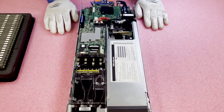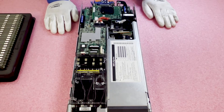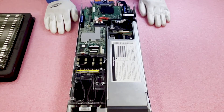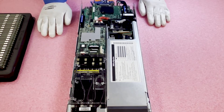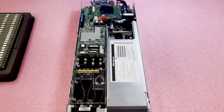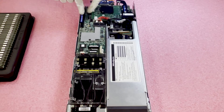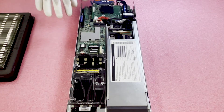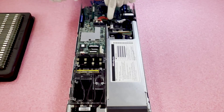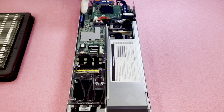Now that we're in, I want to show you a couple of things. There are two CPUs — CPU1 and CPU2. This is important: if you're only running with one CPU, you can only use the DIMM slots associated with CPU1. If you're running both CPUs, you can use all 16 DIMM slots. You'll notice there is an air shroud with a card over it. You want to lift straight up — and I seriously mean straight up — because there is a small board connected via a connector underneath, which is the most common thing people damage when getting into the machine.